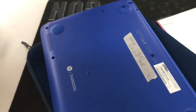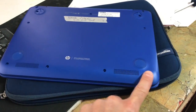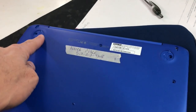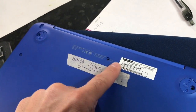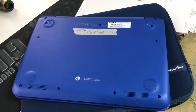Flip your HP laptop over and count your screws — you got 1, 2, 3, 4 on the bottom. You got two over here, and behind these little rubber tabs, only on the back side where it flips, there's two hidden screws. There's also a couple more over here and then one more in the center, so look at it real good, count your screws, and once you got those open...